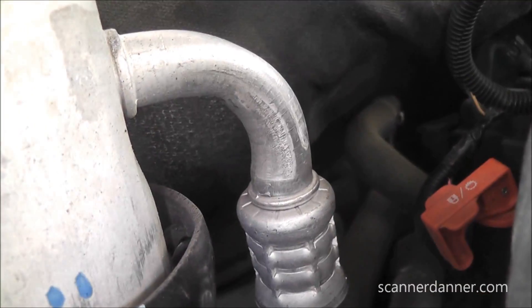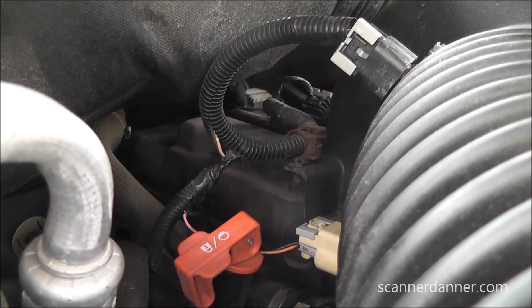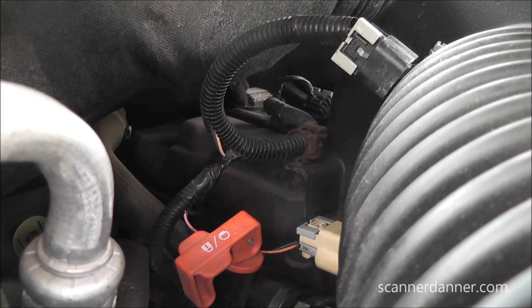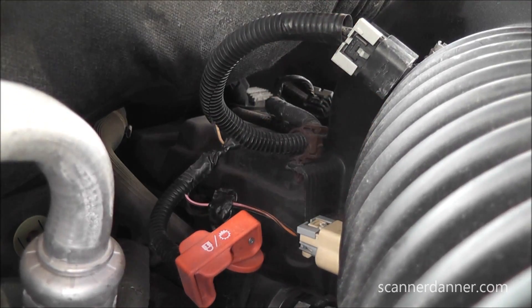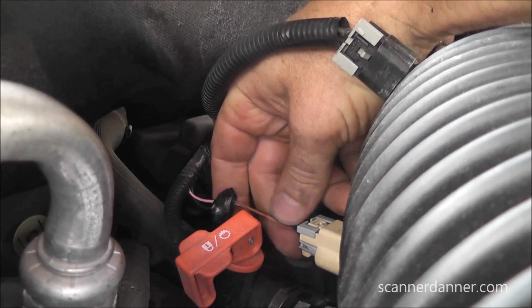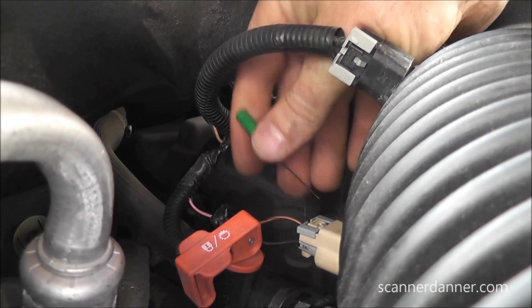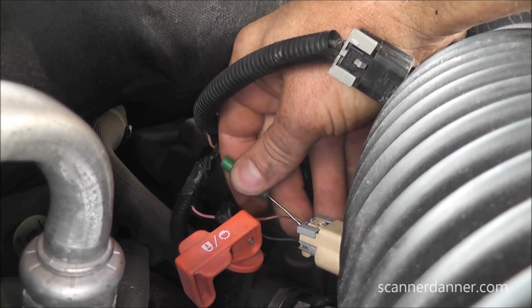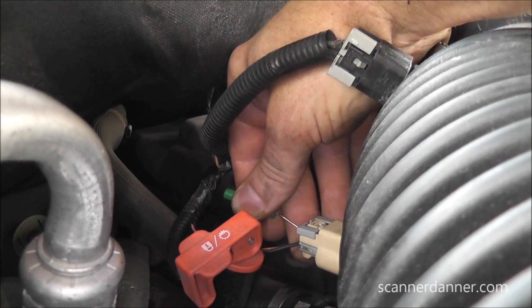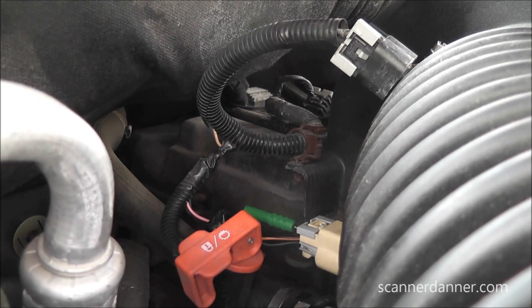I'm going to take this line off again and turn the air pump on. One of you might want to see this solenoid tested with it plugged in - I always preach loaded circuit testing, and disconnecting the line wasn't a fully loaded circuit test. I agree - let's back-probe this connector and do it properly. We also need to switch our test light polarity.